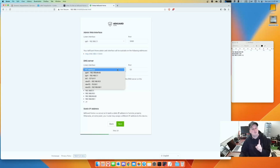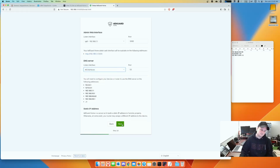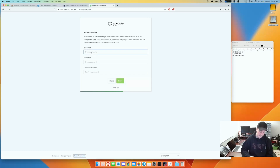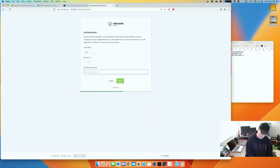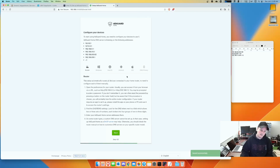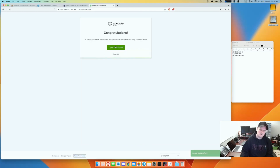Also, just so you know, after we're done with all this, we're going to add another network and we're going to edit the YAML configuration. So we're going to go like this. Keep it here. Next, I'm going to keep it the same username and password as the actual OPNsense box. Maybe it'd be a good idea to change it to something else that you know. So we're going to go root, OPNsense. Next. Next. Done.